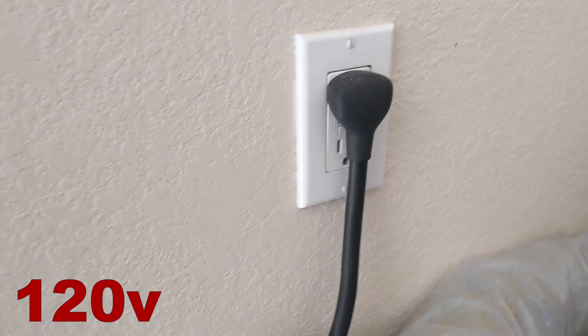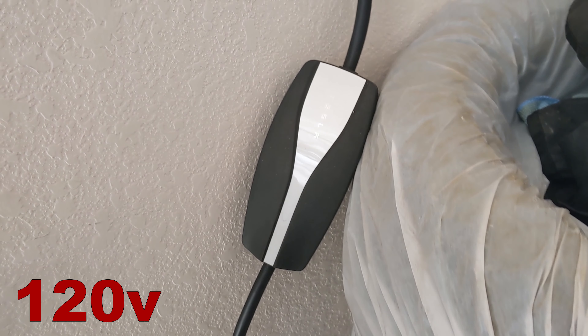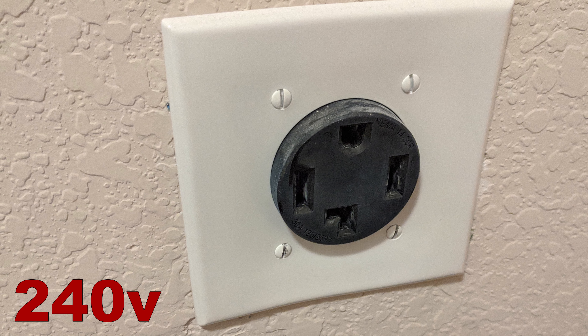You may be wondering how different levels of chargers are going to impact your results. There is a difference between using a standard 120-volt outlet versus a 240-volt Level 2 charger. I currently use a 120-volt outlet to charge my car, and it does warm up the battery a bit, but not nearly as much as a Level 2 charger would. However, combined with preheating the cabin, you can still get most of your regen. The one downside is that preheating the cabin while using a 120-volt outlet is going to use up 2–3% of your battery, since the heaters require more power than the 120-volt outlet can deliver. But I think it's worth it to have a warmer battery when you're leaving.